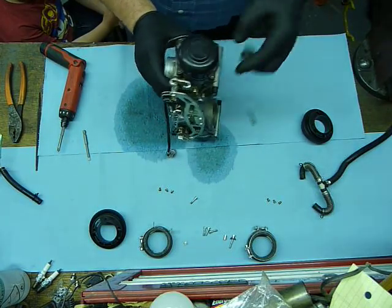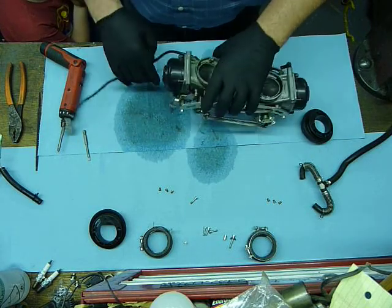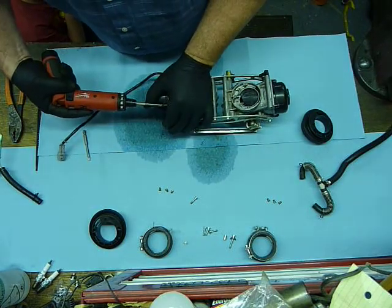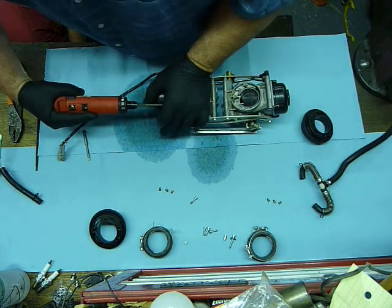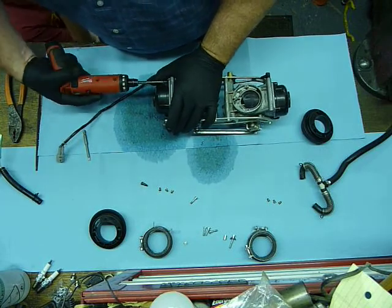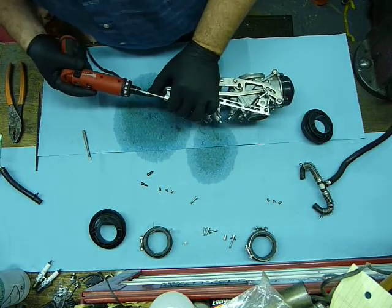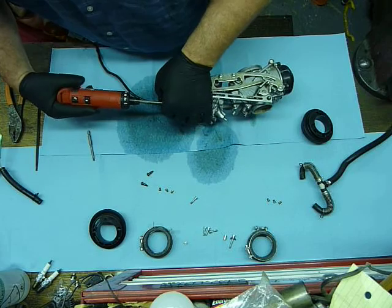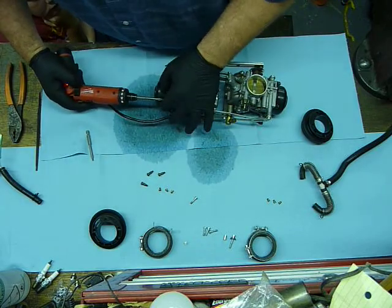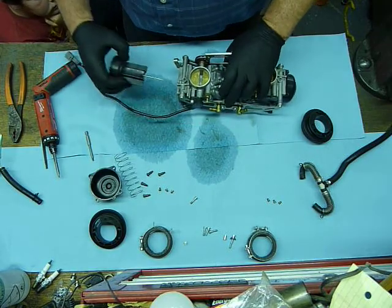The black covers are the diaphragm covers — this is where the slide assembly goes up into. There's a soft rubber diaphragm and a spring underneath here, one for the front and one for the back. We're just going to pop these off. These are shouldered screws, so when you go to put them back together you just need to make them snug — you don't want to over-tighten them or they will cause you grief. Each one of the slides, diaphragms, and springs are all identical, so you don't have to worry about keeping track of which ones go where.